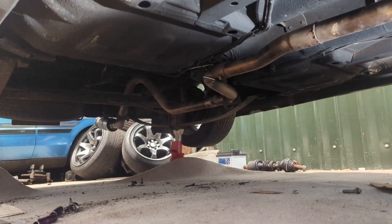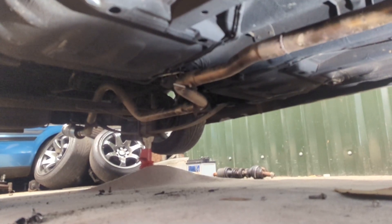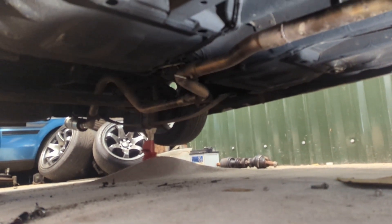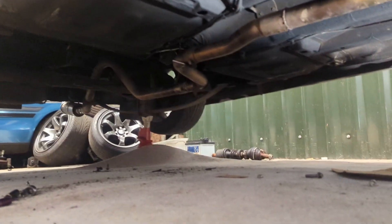I'm going to order a rebuild kit for the carb, so while I wait for that to turn up I thought I'd have a look at what's going on with the exhaust. I'm going to reuse the full length exhaust which I've got — it's 2 inch from what I've read online. 200 brake, 2 inch should be okay. It's all stainless so I might as well reuse it straight through back to the cannon at the back.